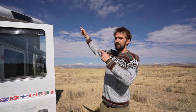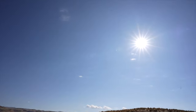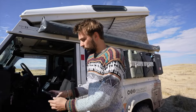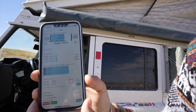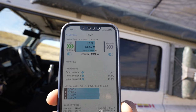This is the perfect place to do a test. We slept here in this beautiful plateau at 4,300 meters altitude. As you can see, the solar panels are both up there, and if you turn around you'll see the sun is perfectly clear from any clouds — it is almost perpendicular to the panel. From the application, the battery is getting around 140 watts of charge right now, which is really good. That means each panel is working at 70 watts out of the 120. If it was a little more perpendicular it would go even higher.